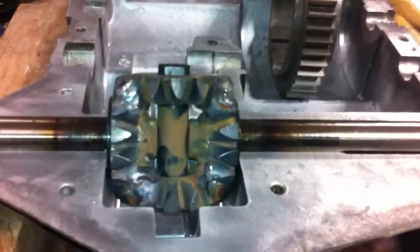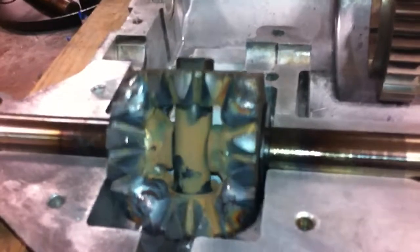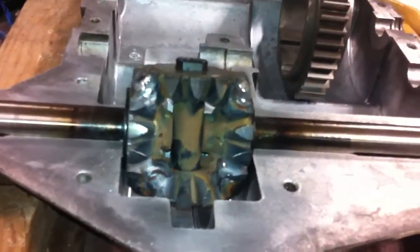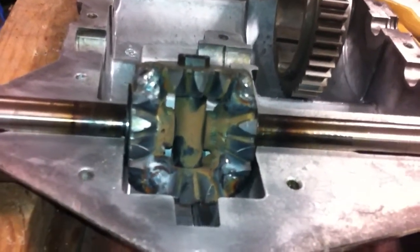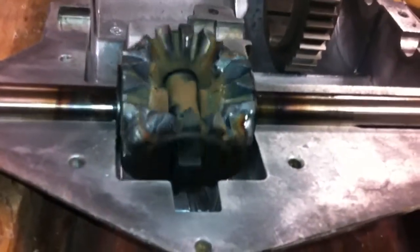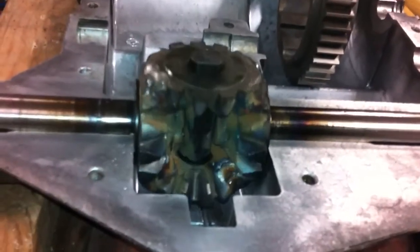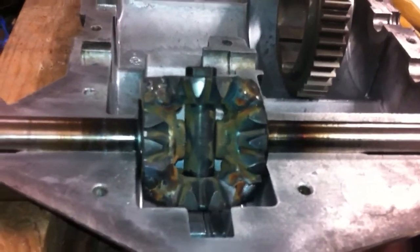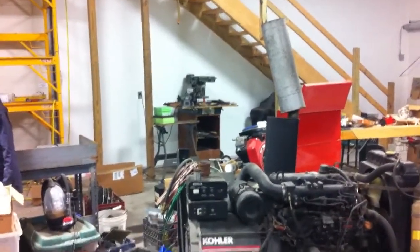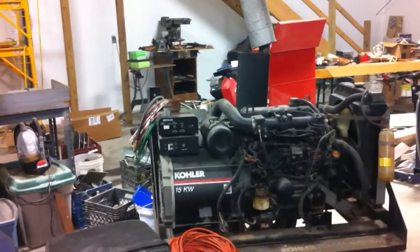When you guys are locking these diffs with those little welders, you're not going to get the penetration you really need. What I do is I take it all apart, clean it with some brake cleaner — the gears look good and everything. Grab yourself a propane torch before you do any welding and just start heating all the gears up as much as you can. It's going to smoke and stink and get nasty, and when it stops, walk away for 10 or 15 minutes and let it cool off. Take it back over to the wire wheel, clean it up, hit it with brake cleaner, and then you're good to go to weld.